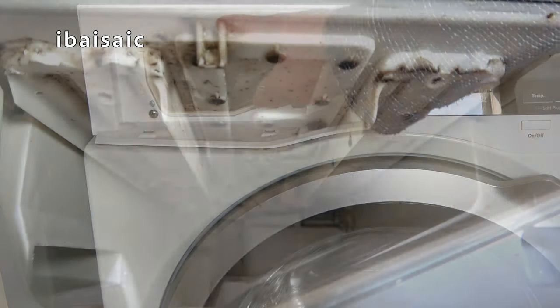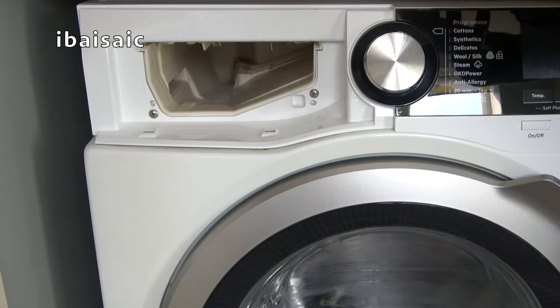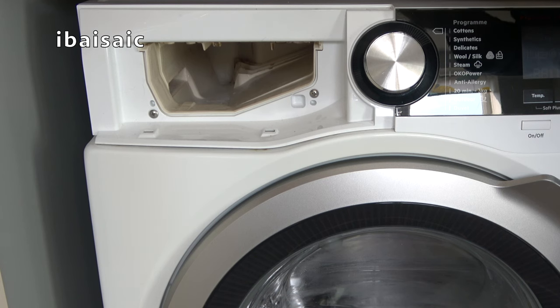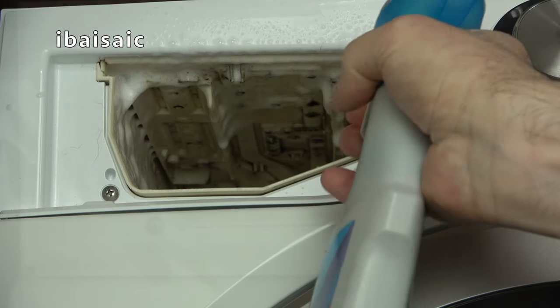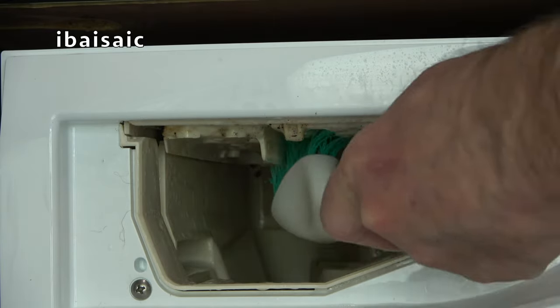From the inside of my washing machine it's not too dirty, but if you've never cleaned out the compartment where your detergent drawer sits you may be in for a bit of a shock. To remove the black stuff a spray cleaner containing bleach is ideal. You could use a steam cleaner if you've got one, but make sure the washing machine is disconnected from the mains before you do so, or just use plain old elbow grease and an old washing up brush or toothbrush. If the inside is very dirty I would recommend a spray cleaner containing bleach. Once you've sprayed the cleaner leave it for a few minutes, then use an old bottle brush or grout brush to dislodge any more stubborn dirt.